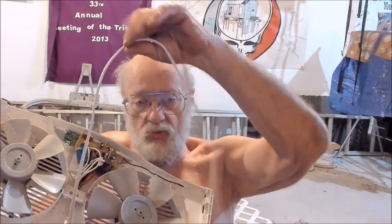And the fuse comes up, it takes one line of the power cord. It is attached to one line, it goes through that fuse and then on to the rest of the board. So if that fuse blows, 120 volts really isn't present at this board anymore, so the fuse has got to work, and in this case it does. So something else is at fault here.